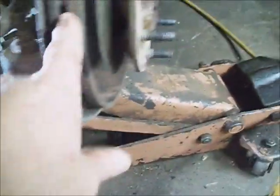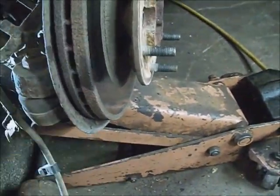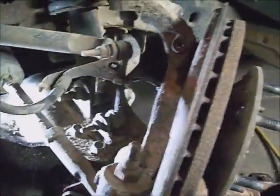If you're reusing the rotor, you might have to make a bolt nut combination off of the caliper support ears and screw the bolt against the rotor with a shim behind it so it doesn't tear the rotor up. All this is getting replaced, so I can just pretty much take a sledgehammer and beat this sucker off there. I'm gonna give it a shot anyway. Just leave the cable hanging loose. It's got to feed through the back of the housing.